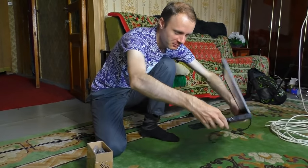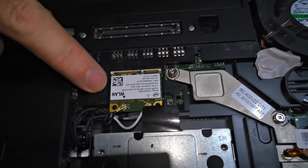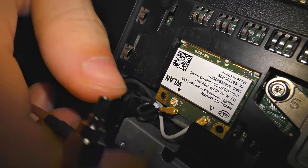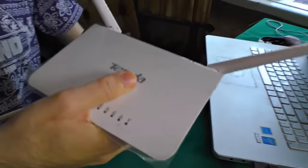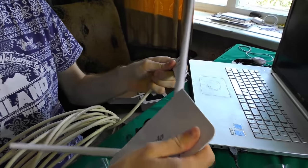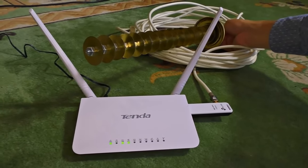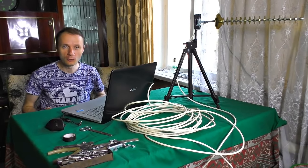Let me show you how to connect it directly to a laptop. Let's remove the back lid. I can see there is a built-in Wi-Fi adapter — wireless local area network, written on it. I need the black connector. Take the pigtail and plug it in — it doesn't suit. We are going to order one that is going to suit. Actually, I think it's better to make a hotspot for all devices with phones. To make it real, I connect a Wi-Fi router to the adapter — any router may suit, but it must have a USB input. As a result, we get the free Wi-Fi signal amplified by the antenna, then we use the router to share it. You must make the router work on a frequency different from the one you catch, otherwise it will start catching itself. If you don't want to make this gun yourself, you can buy a ready-made one — it is called BDM2.